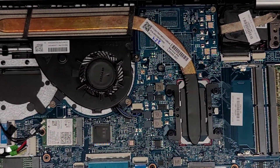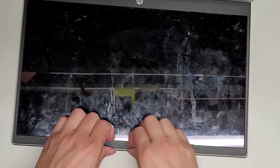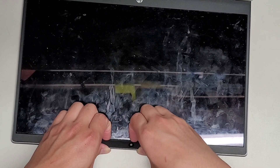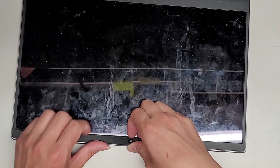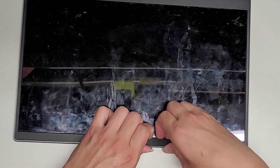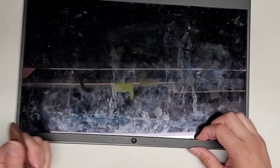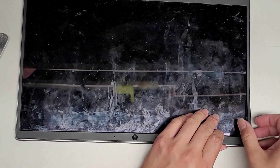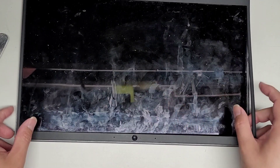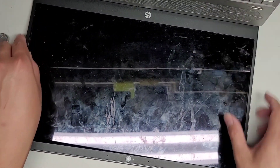Let's go ahead and begin the screen removal process. Now that we've removed the battery and pressed and held the power button, we're going to open this up. On this model they use some adhesive — it's really annoying — but we're going to pull this up. I already took this out one time so it's going to come out easier than usual. Basically what we're doing is we're twisting this bezel so that the inside part of the bezel goes up and this side goes down — that's how you undo these clips, latches, and adhesive. If you have a thin plastic tool like a credit card, that helps. We're going to go along like that.